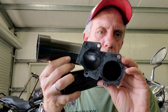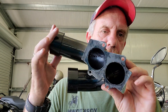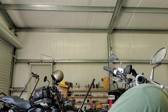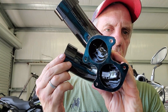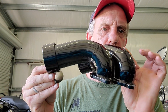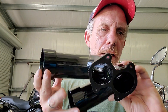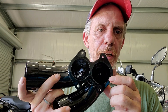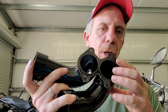I'll show you a new one so if you don't have one of these intakes you can see what one looks like new, because this well-worn one doesn't do it justice. This is what a brand new one looks like — for the newer bikes, very similar in design. Both flanges are a little different; these are 45 millimeters to give another millimeter for the newer throttle bodies.